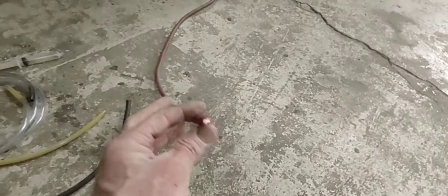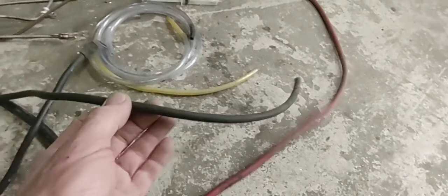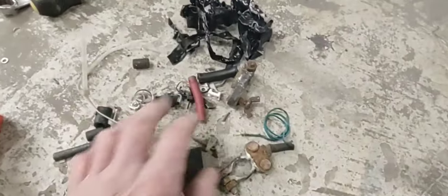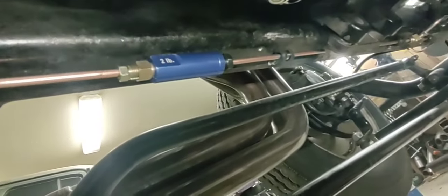I went ahead and did a whole bunch of stuff on the old coupe. Replaced the power wires — this black one here is a two-gauge coming off the starter, and the old one going to the switch was way too thin — thinner than what we used to run to car stereo amplifiers as teenagers. There's all the brake lines — I redid them all. All that garbage that was holding everything on is going in the trash. The front brake line goes along the master cylinder bracket to a nice little clamp, to the residual valve, another clamp, goes up to the T — I took it off and blew it all out — then a new brake line going up to the caliper.